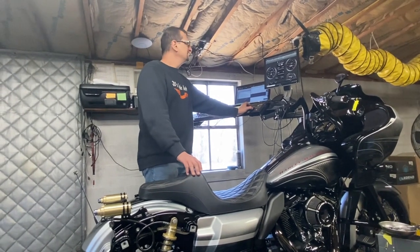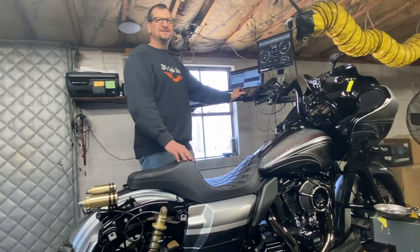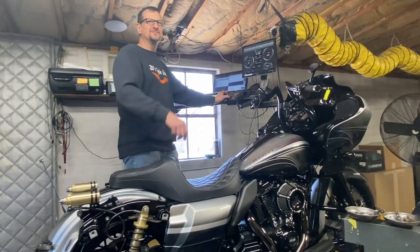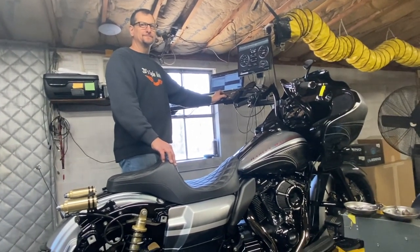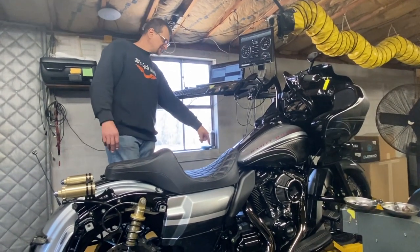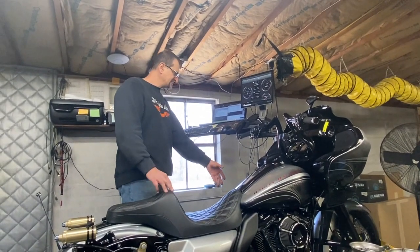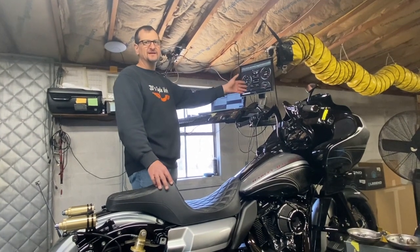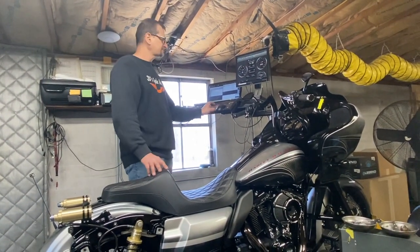You know, the old machine, in this time of year, I get big power numbers. Then come spring when it was wet and warm and humid, they would drop down about 5 or 10. Obviously, there's a thermometer that in real time picks up what the temperature is and puts the info into the module over here. It records all that. It's on the side of the machine where it's kind of a neutral area, so it's not in place of fans or heaters or anything. You want that to be what it should be around the bike.